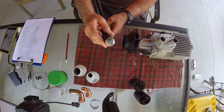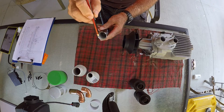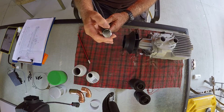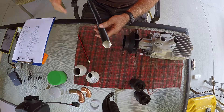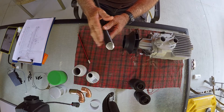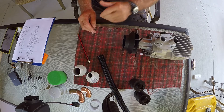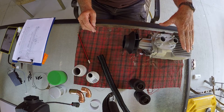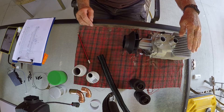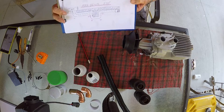The next thing is the hose. Heaters come with an aluminium corrugated hose with an inside diameter of about 24 millimeters - roughly an inch - and about 500 millimeters length. This is easily crushed, squashed, kinked, and bent, creating restrictions. There are limitations on hose length and number of kinks. The best reference is the Eberspacher site - as these heaters are almost identical knockoffs of the German Eberspacher, their maintenance manuals and guidelines are a good system to follow.